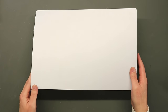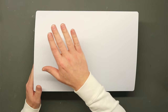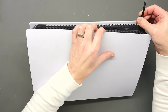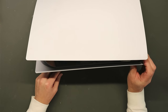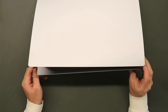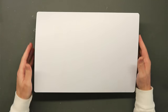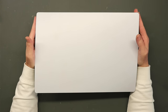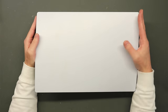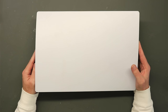Hello everyone, welcome back. In today's video we have another PS5 — this one is the digital edition which we are going to repair. It has a two-second blue light of death issue. Let's quickly plug it in to check: power lead in, watch for the blue lights — we get a blue light and then it goes off. So two-second blue light issue. What we're going to try is a tool called UART, which stands for Universal Asynchronous Receiver Transmitter. It's a way that chips on a motherboard communicate with each other, and we can read error codes from it to tell us what's going on.